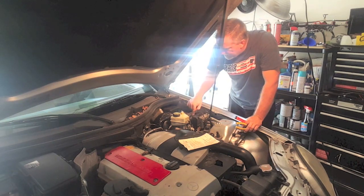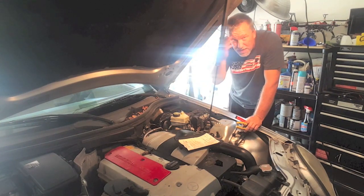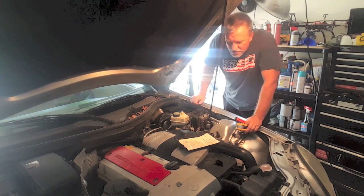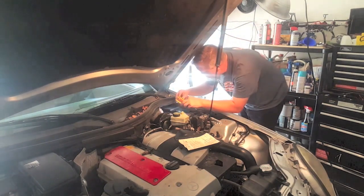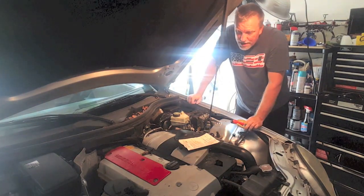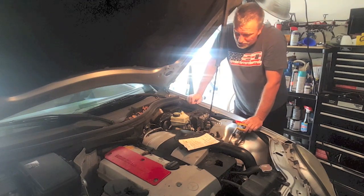All these are good with the exception of 31, which is the cigarette lighter and glove compartment light, which I kind of figured since the wires are sticking out in the center console. So that's not it. 24, we're good. Yeah, so all of these appear to be good. So I guess we will head to the trunk and see if all those check out.